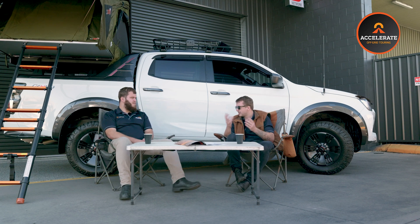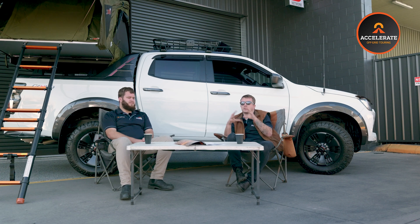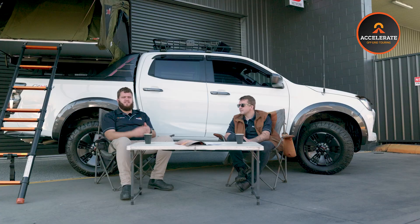There's a lot of legislation around lithium batteries. In a caravan, you can't have them in a habitable area unless they are sealed. It's different in a car — vehicles are not a habitable area per se; they're a mode of transportation. In a D-Max where you're not sleeping in the car itself, in the confined space where the lithium battery is, those regulations don't apply. You still want a top quality lithium battery with all built-in protection devices, but the effort of sealing and venting directly outside is more so for caravans, RVs, or troop carriers where your living quarters are with the lithium battery. In this build it's behind the back seat in a mode of transportation, so not required.